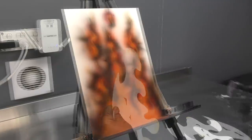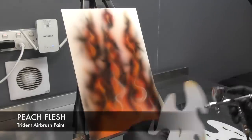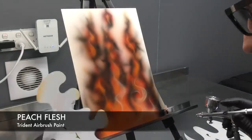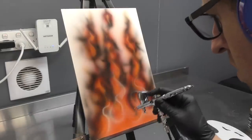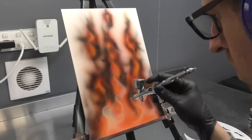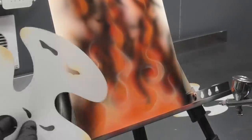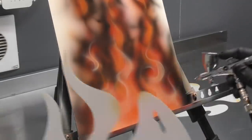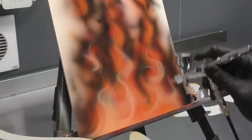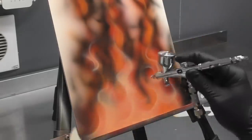And what I'm doing is spraying over the entire orange section. So virtually just cover the panel. It's the easiest way to do it. The reason for this is these do act like a normal candy would as a dye, and they will bleed through if you do not seal them within every single candy coat. So every time you lay down a candy, you want to then seal it off with that Createx Wicked transparent base.